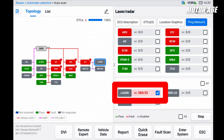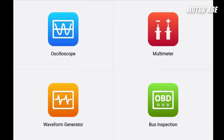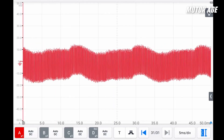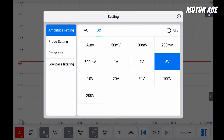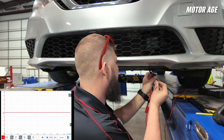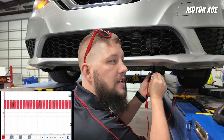It looks like the module has been pinged 25 times — this really is a bit of an intermittent communication. Under the ITS scan, it's still counting up and doing our ping test. Now if I go back to the home screen, select over to Measurement, and go to Oscilloscope. I need to set up my channels, so I'll go to channel A and change our voltage because a CAN bus is going to be 2.5-volt biased up and down. It should be fairly active as that's the only module on this ITS network.